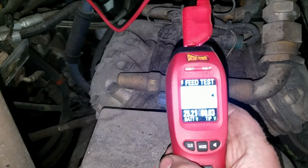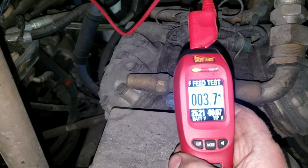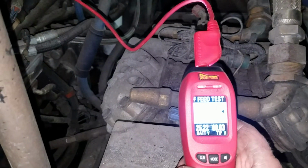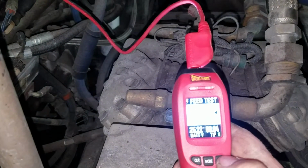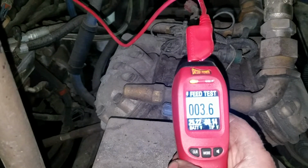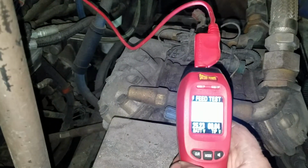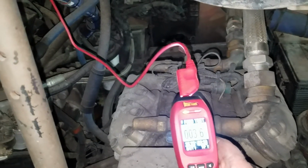I'm on limited time right now, but I thought I would at least show this diag to help out if you've got a charging issue on a bus with a DN50 24 volt alternator. Let me turn this buzzer off. There, sorry guys and gals. Anyway, I'll make sure I put the spec in the description for the field winding resistance. Like I said, knowing this technique helps you diagnose if it is an alternator or not.